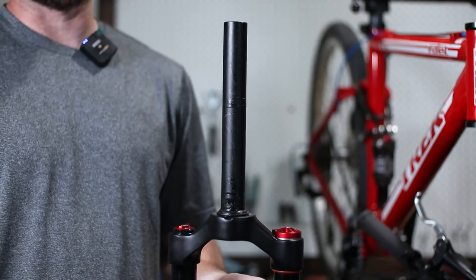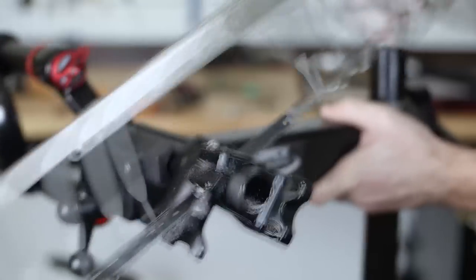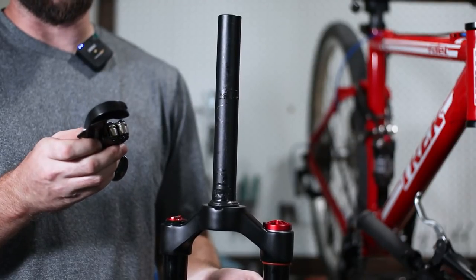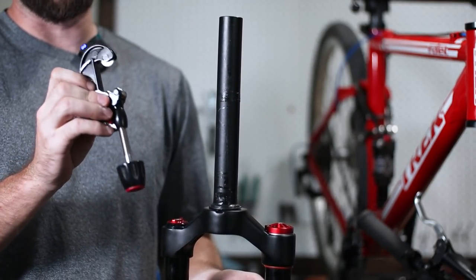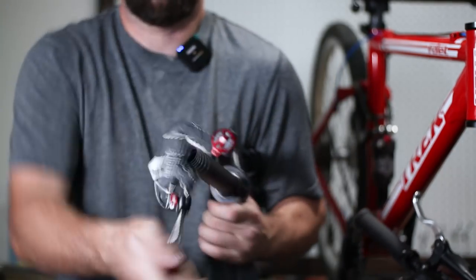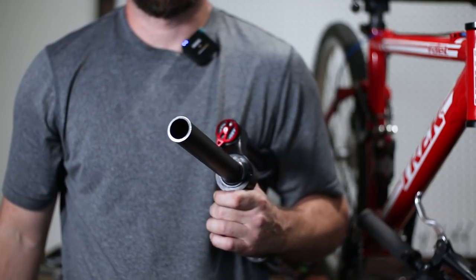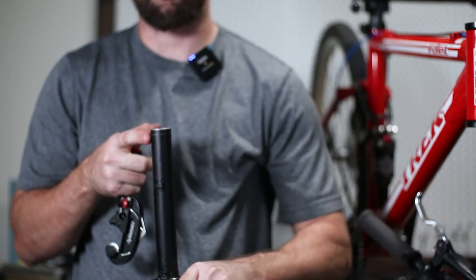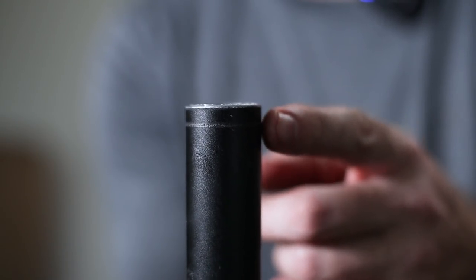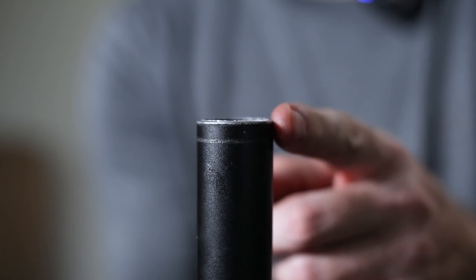I have to cut the steer tube, and the whole time I've been ghetto rigging some sort of saw guide. I was talking to my dad and he said I need a pipe cutter, so I went ahead and invested in one, but I haven't had a lot of luck with these. Let me know in the comments if you've used one of these pipe cutters before. Luckily Home Depot has a good return policy. The reason I don't like those is because it bows out the metal and leaves a pretty big lip that you have to file off — it's a lot of work. So I think a saw guide would probably be better.